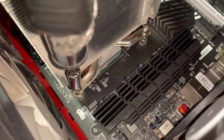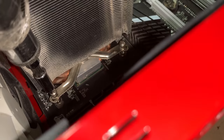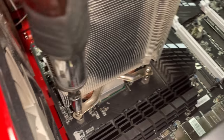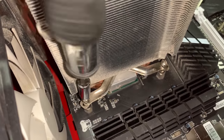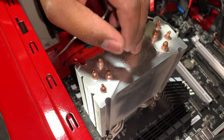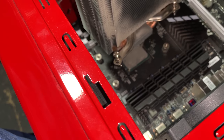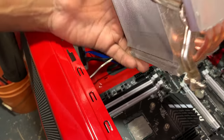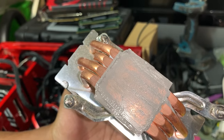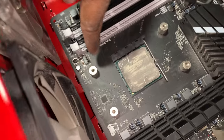slowly, come on, I forgot that this screwdriver is not the screwdriver that I usually use for this type of job because of the head. So what I'm gonna do is remove this CPU heatsink, not pull too hard. Oh, it's doing a better job now. Okay, so it did not pull the CPU because I did some twisting. And you can see that delicious thermal paste. And as you can see right now, we have our CPU. We're gonna clean off that thermal paste.